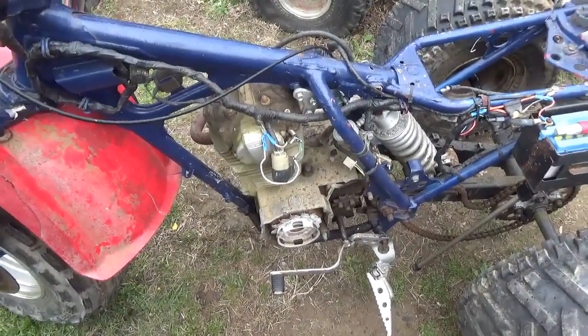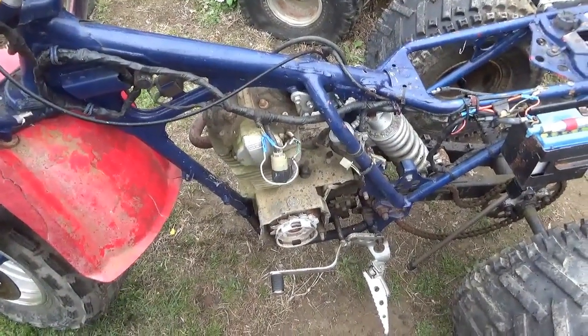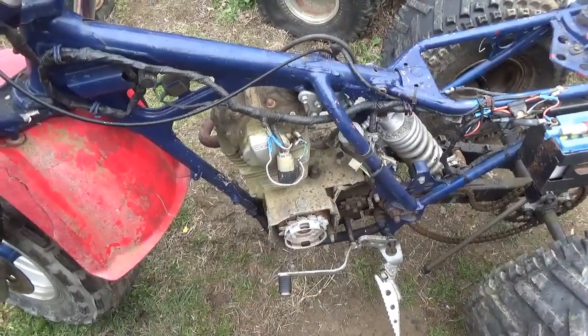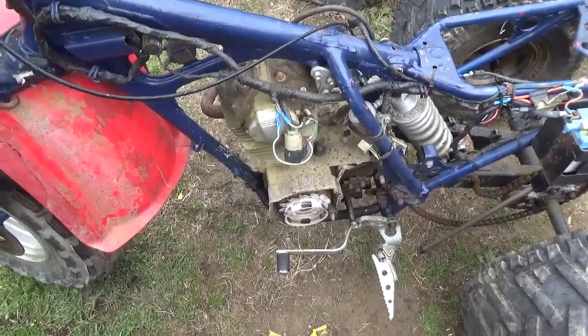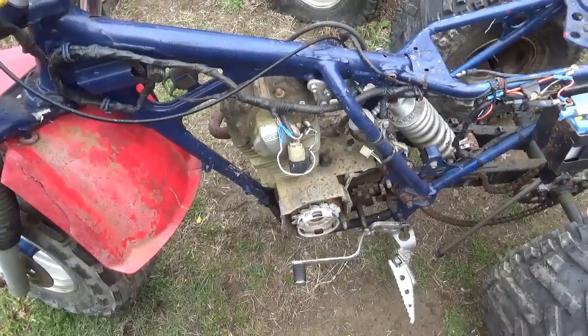The only oil lubricating the piston and cylinder was what I poured in there before. And that was relatively thin. So anyway, what I'm going to do is, once again, let that oil soak in there. Hopefully the rings won't be seized. If the rings are seized, I'll have no compression and this thing will be quite dead. And I'm going to give it another try tomorrow.